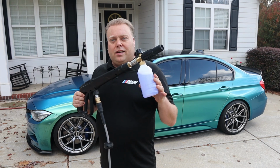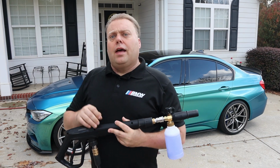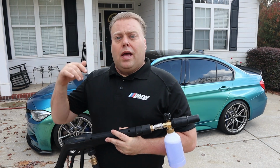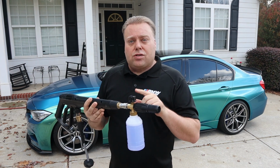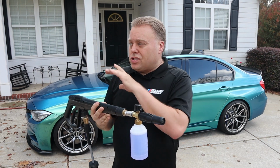So what I have in here is 30:1 dilution ratio of Incredible Suds by DIY Detail. I will have a review out on the soap. It's probably out already. I'll have a link in the description below to their website, and I have a discount code CarsWithKeith as well. Now I already measured this as a 1.1 millimeter orifice that comes with this, so you don't have to change it out. It's good for this unit.